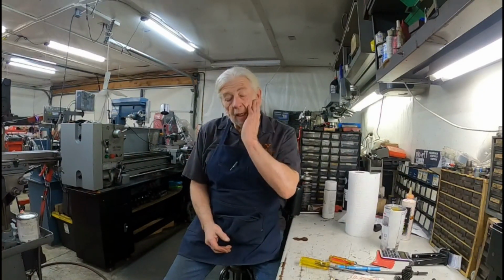Well, I hope you enjoyed that a little bit. The distributor I ended up taking to a friend of mine who has an old Sun distributor machine, and I had him spin it. He didn't want to be on camera or anything, so I didn't get any video of that. But as it stands right now, we had changed springs around. It's got 22 degrees of advance in the distributor, and it's all in at 3,000 RPM, which should be pretty good. The advance starts at about 900 RPM, and all the centrifugal advance is in at 3,000.